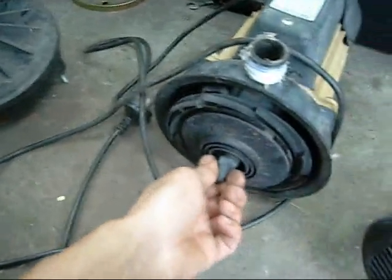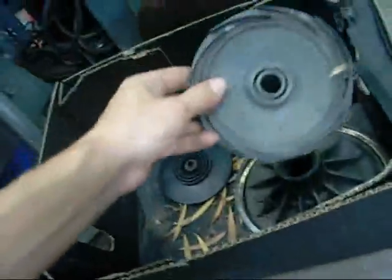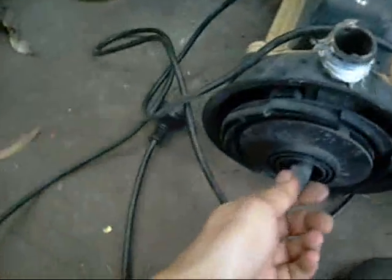This one doesn't run — it just makes a loud humming noise, like the run cap's gone. This one does run just fine, but I don't know how much of its actual pump housing is in here. I'm guessing that's probably most of it. There's a deflection plate and another impeller, so most of it is there. As long as the silicon carbide seal is still there — if not, the one off this one might fit. Time to troubleshoot them.